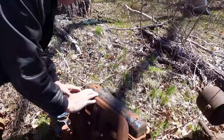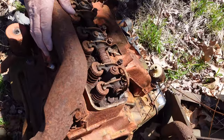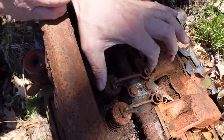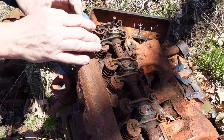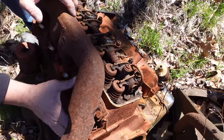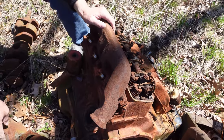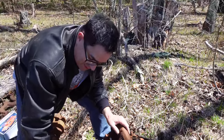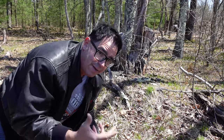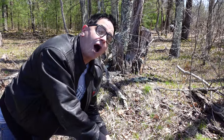So what is an overhead valve design? Here's the valve cover - we take it off and these are rocker arms right here, exhaust rocker, intake, exhaust, intake, et cetera. These allow for much better, more streamlined ports. The exhaust ports come out of the heads and go into these exhaust manifolds rather than going through the block as they did on the old flathead. The point of the overhead valve pushrod-type engine is superior breathing thanks to the cylinder heads mounted on top of the block.